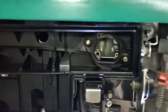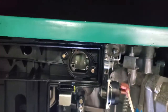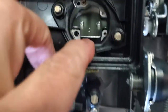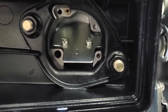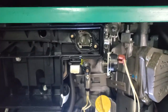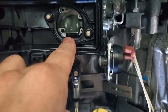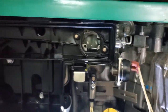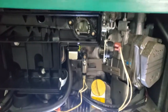Notice that plate opened up more - if you go look at the video from a couple minutes before, you can compare. The electric choke is working, it started up good, and our prime is working. The reason I started it is I'm going to warm it up. I'm actually going to do a fuel filter and an oil filter change - a basic service. The air filter looks really good so I'll leave that. I'll put you on pause.